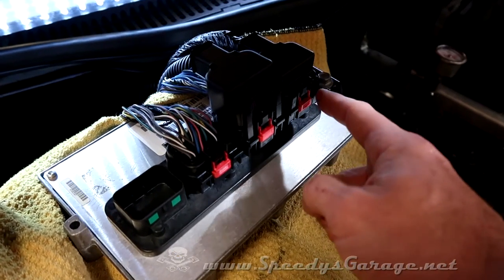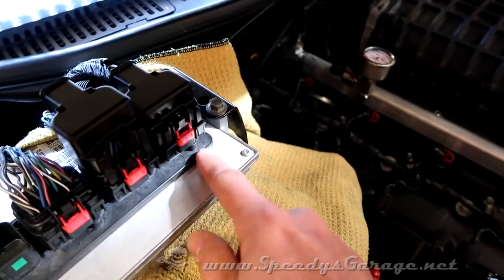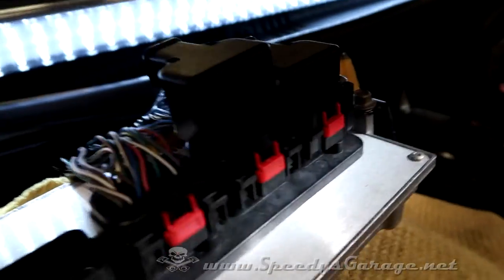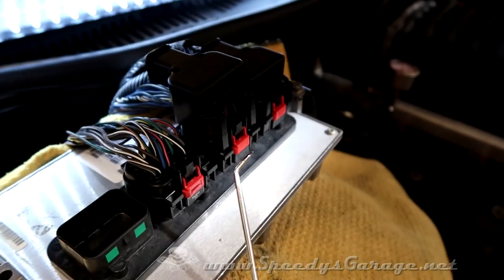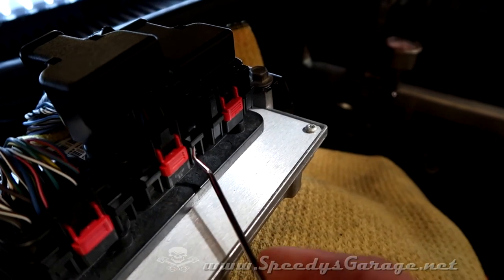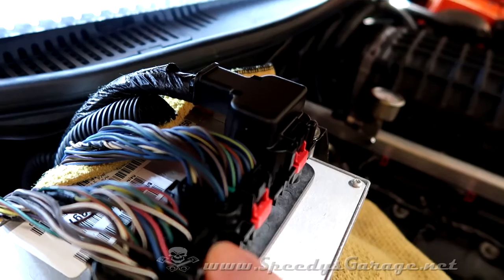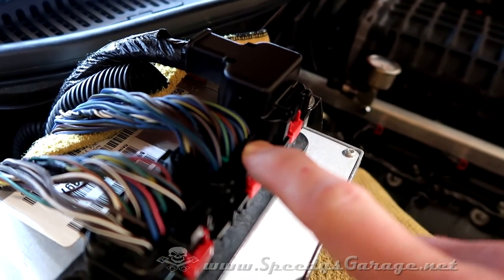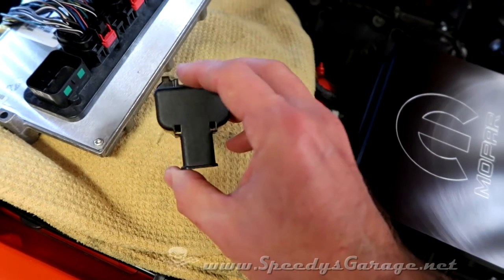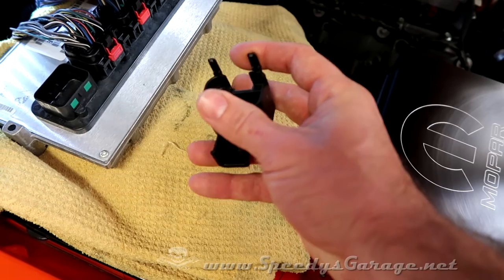Once you have the PCM out, you'll notice it has three large 38-pin connectors. From the top down, where your bracket is: this is connector one, connector two, and then connector three. The fourth one is actually empty — there are no pins in there. The next thing you want to do is use a small hook. You very gently pry back on these two legs — there are two on each side. Then you can lift the cap off and that exposes the pins so you can see which wires you actually need to work with. There may be a special service tool available for that since the cap has four holes in the top, but you can do it with a small hook. Just be really careful as the plastic is delicate and brittle.